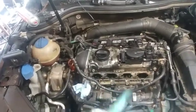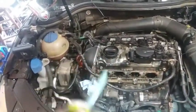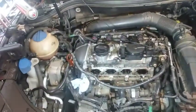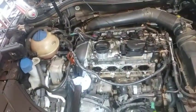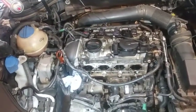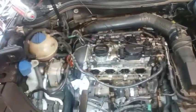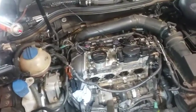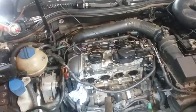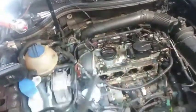I don't have a sandblaster or anything - it won't need to look that perfect. I'm simply going to take a wire brush and brake cleaner, put a little tub in there and just go to work cleaning all that carbon buildup out. Brake cleaner works extremely well - it's a good degreaser, I'll put it that way. So I'm going to use that, get everything cleaned up, and we'll be back.